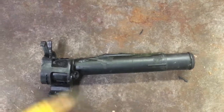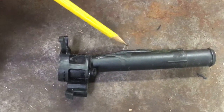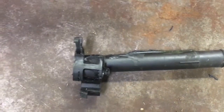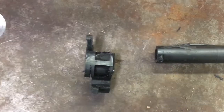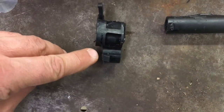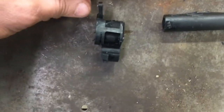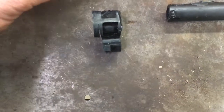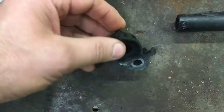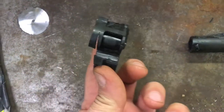Here I use the hacksaw blade to first cut away the section that attaches to the long intake runner. Cut this piece off. Then I use the air saw to come in and cut along parallel with the back of the manifold. You cut a part of the port out and the gasket falls out. You're actually cutting through a little piece of the metal also that's inside there.